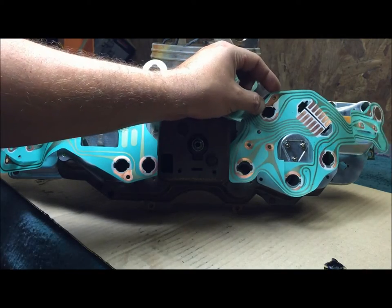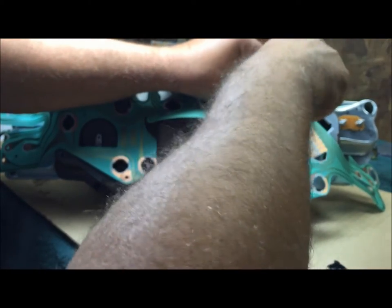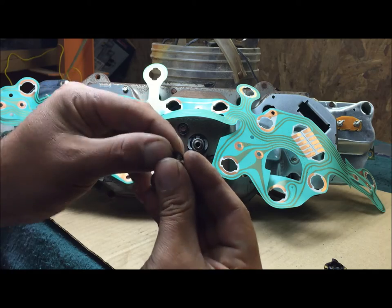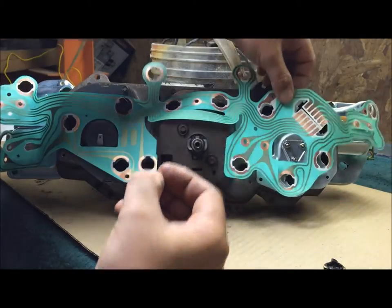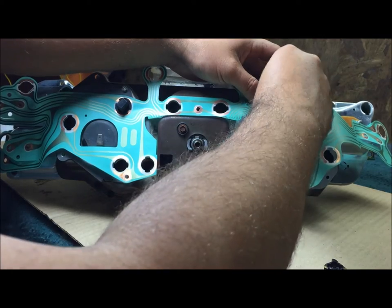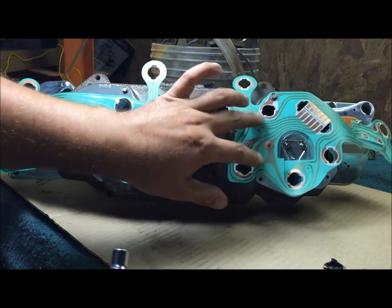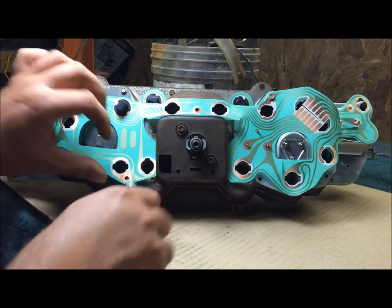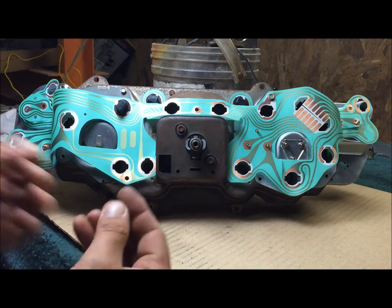See, that's why we didn't tighten it - because now we're going to take this off for the ground. Anytime one of these bolts or screws is being used as a ground - anytime you're grounding the circuit board to the housing - it's going to have these little washers in there. It's all factory stuff. That screw grounds the circuit board, that's why it uses that washer. Don't over-tighten them, you'll strip them. Since this is grounding, we're using a little washer.